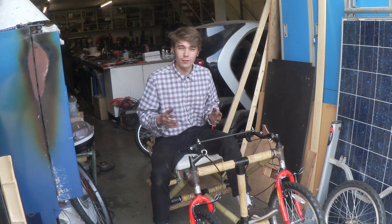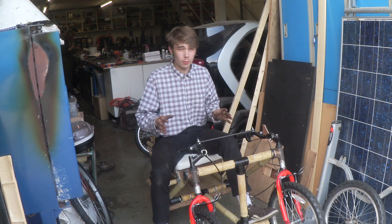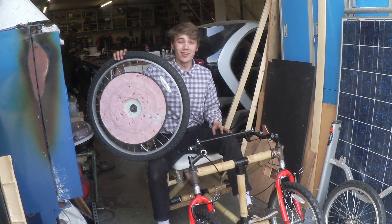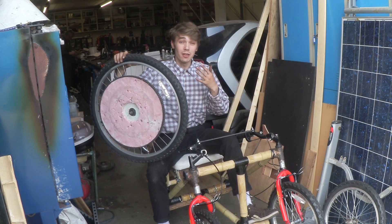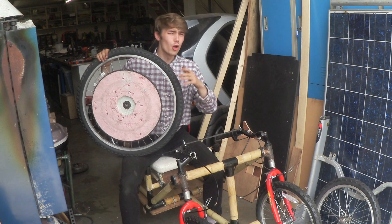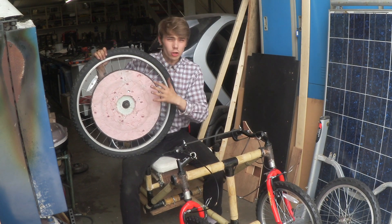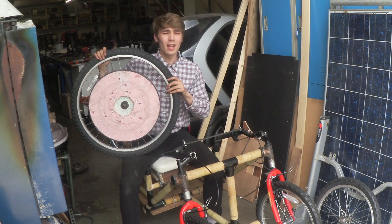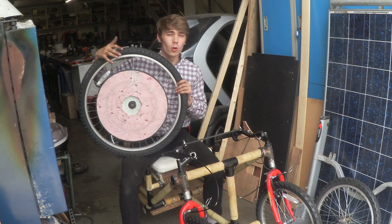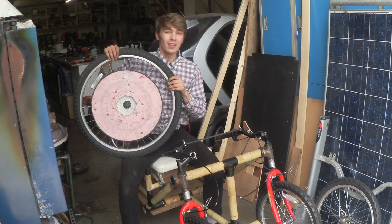There is a real reason why I want the wheels oriented like that, and it's not just because I like it. An axle with two wheels can be a little troublesome, especially if you don't spend the money on a real axle. With a single rear wheel, all I really have to do is chop the back stays off a bike, position them correctly, and attach it — it's going to be a piece of cake. Now, this wheel has a humongous cog on it. Rob did a video on that — video number 1084 — going through the technique. With this massive cog we should get a huge gear ratio, and we worked it out to be something around eight to one, which is massive. So this is going to be awesome.